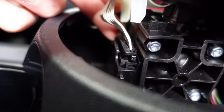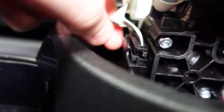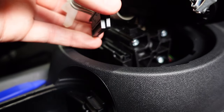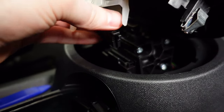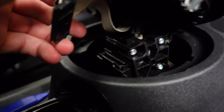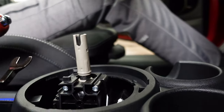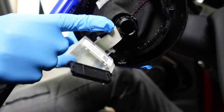Now remove the cable connecting the gear selector by pushing in the little clip and lifting the connector. Squeeze the clips on the side — you can see them better this way — squeeze those in so you can pull straight up. The gear selector is now completely disconnected electronically. Use a pry tool to remove the retaining clip and get the selector up and out of the way, giving much more space to lift the center console.